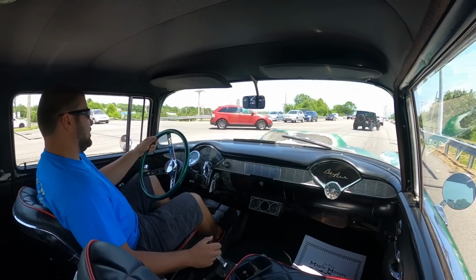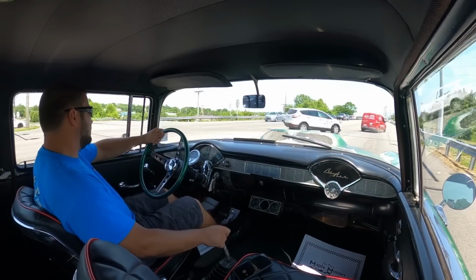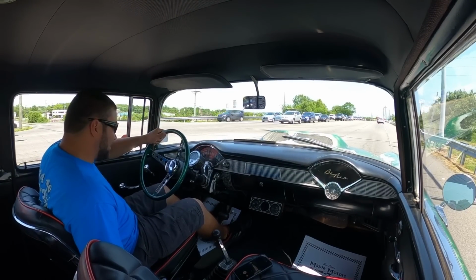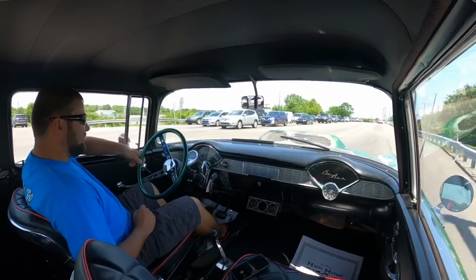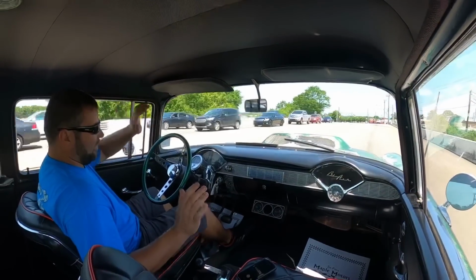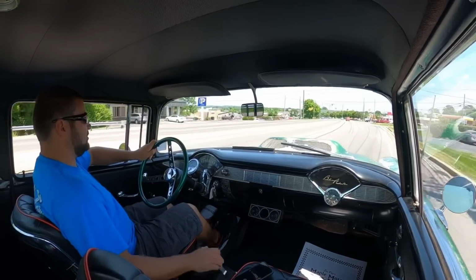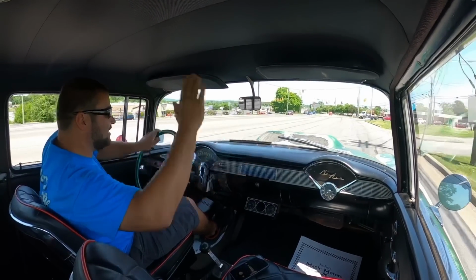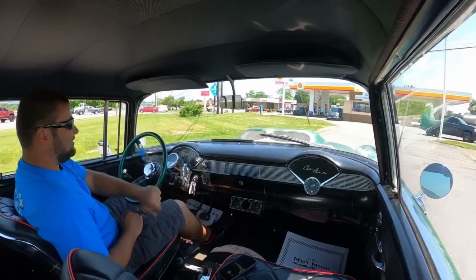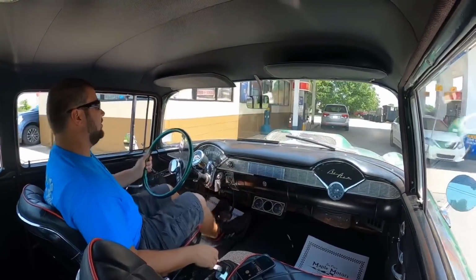Of course, we're going to go to the gas station and put about $20 worth of fuel in this ride. Well, we'll do 25. That's what I've been moving it up to. That clutch is literally right off the floor there. As far as the steering goes, got a little bounce. It's got a right pull, and a pretty significant one at that. It is pulling off the road there. Feels pretty tight though. No turn signal, so I guess I'll just point and put my hand up. Yeah, it was bouncy like that mostly because of the gear ratio on this. It's just geared that low.